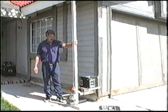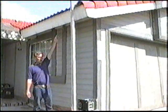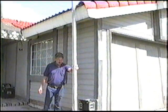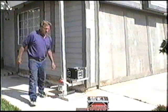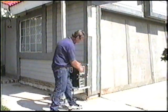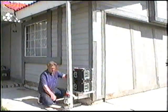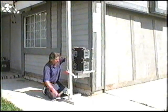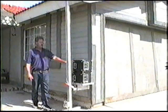You've seen it work and you know it kills. But what happens if the infestation is up in an upper timber, up in the rafters, or in the fascia board? We have the limo lift system that comes with the microwave. Set your unit on the tray. If you want to decrease your treatment time, you can use multiple units stacked one on top of the other. Do your treatment, and as soon as you finish, raise it up, place your shielding in place, and continue on until you finish your treatment.